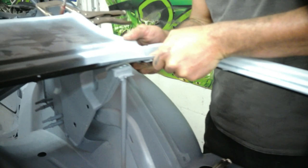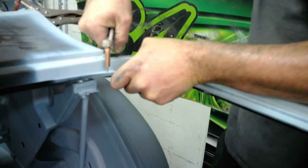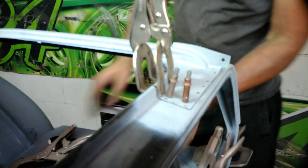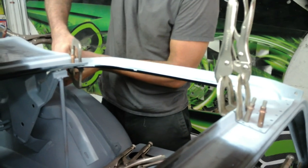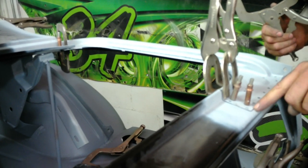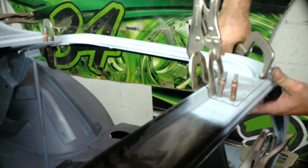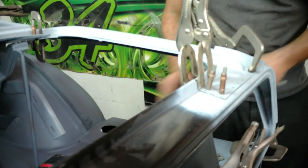This goes under that front panel. I want to put a better vice grip on this to really pull it up before we put a couple screws in. With this right here, the idea is to get this back lip — you don't want the tail panels rolling in a little bit, so we're going to pull it out and stick a vice grip on it. See it's a little bit straighter now. We'll hammer this down and make it flush when we put our screws on. That side's on — let's go do the other side.